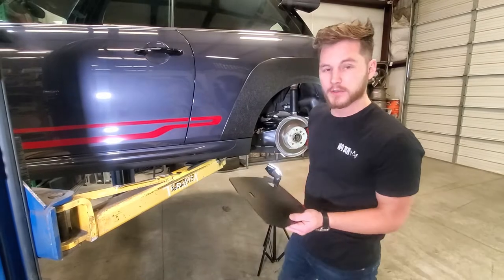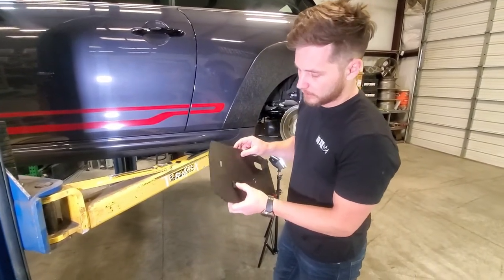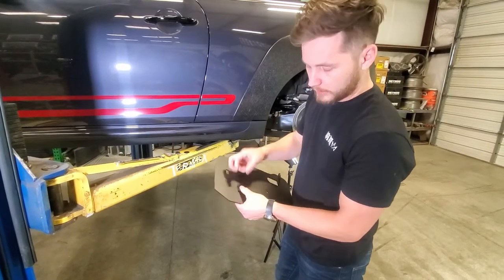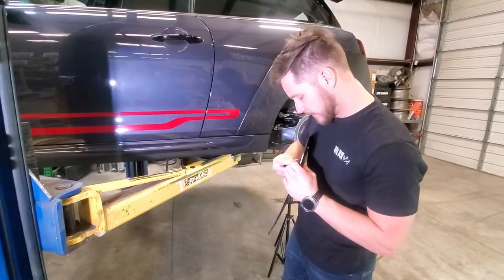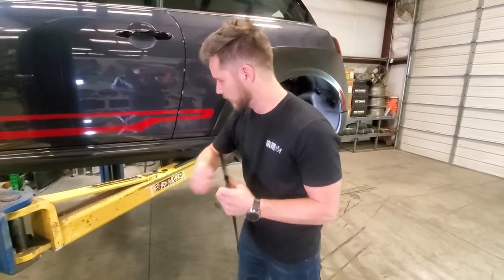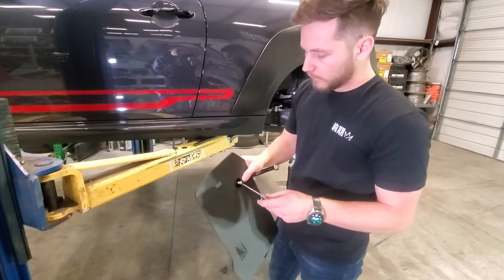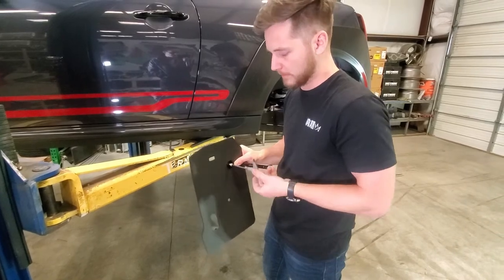Before the actual install, we're going to prep the flap for mounting — same as the front. Mount two nylon clips on the textured side with the logo, at this hole and at this hole. Repeating the same steps as the front, take the M6 button head, start it by hand. Hold the clip with the 19 millimeter, pinching it and keeping it in the groove, and take the four millimeter Allen key to secure both clips onto the flap.